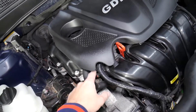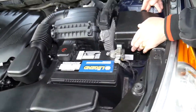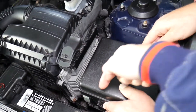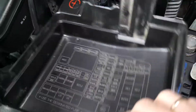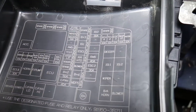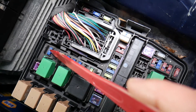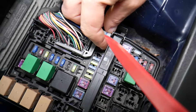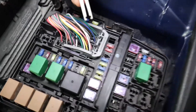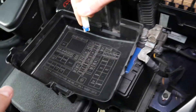Most of the time you don't even need to replace them — you just have to clean them in a specific way and they start working again. Open the fuse box — you have one tab here, one there — squish and pull straight up. The fuse we are looking for is known as Sensor 2, a 15-amp fuse. Count one, two, three, four, five — use the fuse puller, grab it, go on top of the fuse, and pull it out.